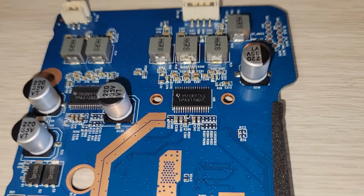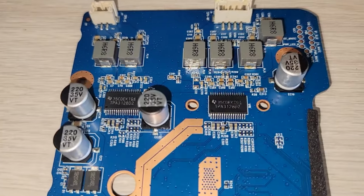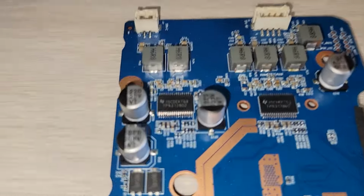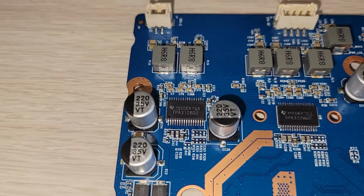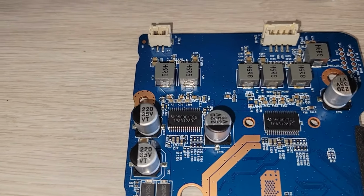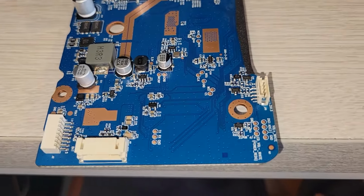Now the amplifier, they're actually two of the same chips. TPA3128, 30 watt per channel amplifier chips. So yeah, each of these drivers is getting 30 watts. That's actually a lot. And the spatial driver too. But I think there's the DSP to limit it for the spatial driver, and it's in bridge mono mode. So I think they limited it to, and I'd say it probably couldn't take much more than 10 watts. But still, wow, very, very nice quality components.